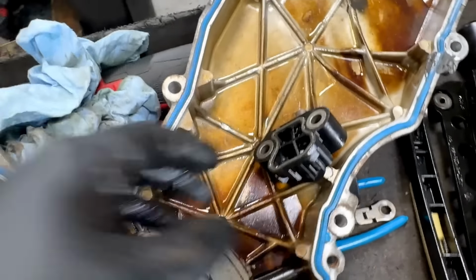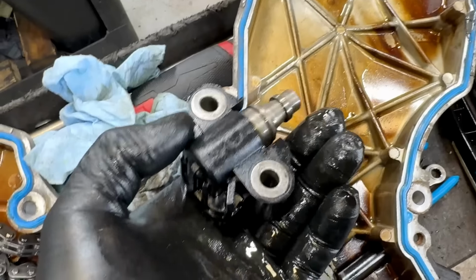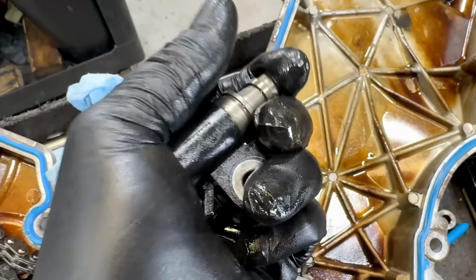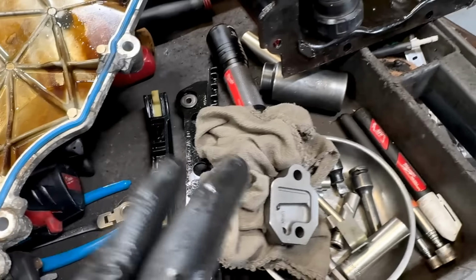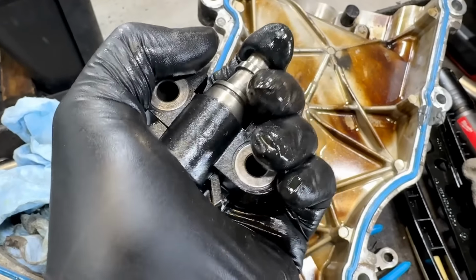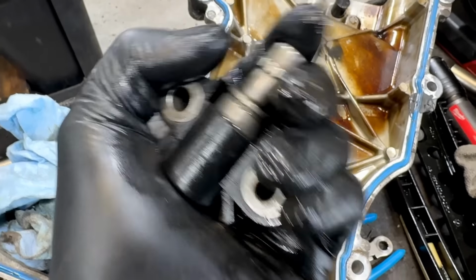I wonder if these cheap inferior tensioners they're including in their kits that are coming fully out, putting extra stress on those chains and never actually relieving them, which was kind of a failure, kind of a design flaw of the ratcheting ones. I wonder if they're coming out, they're locking solid. When this first came out, I couldn't even move this at all. It was rock solid. I lean on it, rock solid.